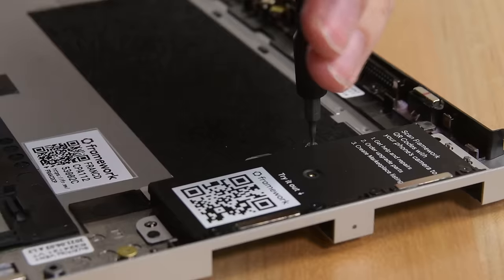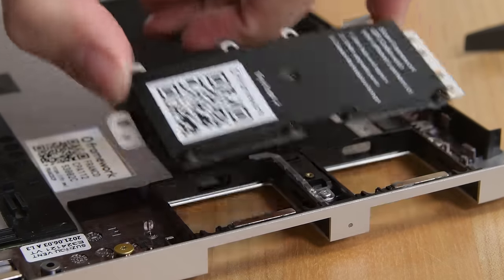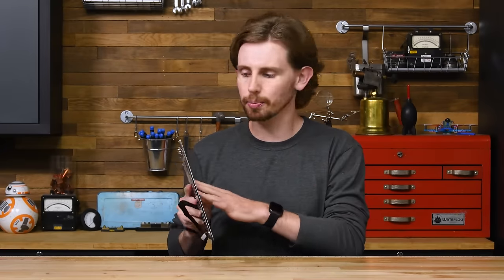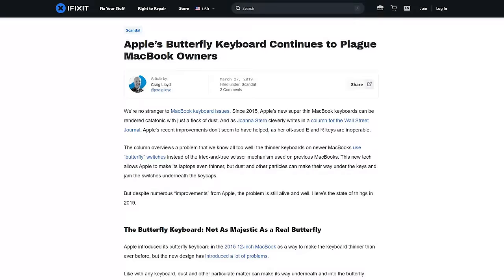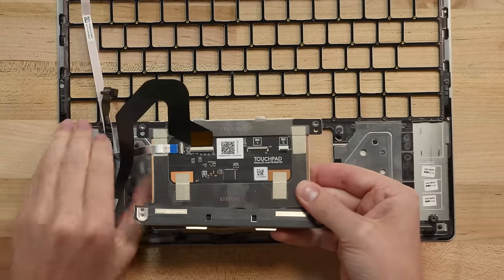There's not much left in this cavity, but I am curious what's under these indents where the ports slide in. A few screws and an aluminum cover reveals a light guide. Let's take a quick look at the keyboard assembly. You probably won't be surprised to learn that this is all modular. The keyboard is held down by at least 50 screws, but it can be replaced — hint hint, Apple. The trackpad on the other hand is as simple as any: four screws and it comes right out.